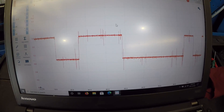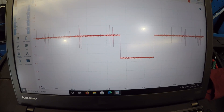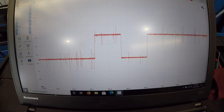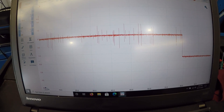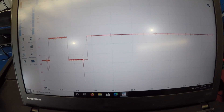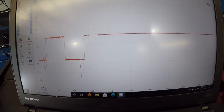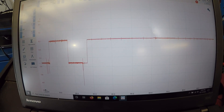The signal is a little bit crap visually, but as you can see the cam signal is working pretty much perfectly - it's what we'd expect to see, zero to five volts. So if that's reading correctly, we suspect there may be a cam-crank correlation issue.